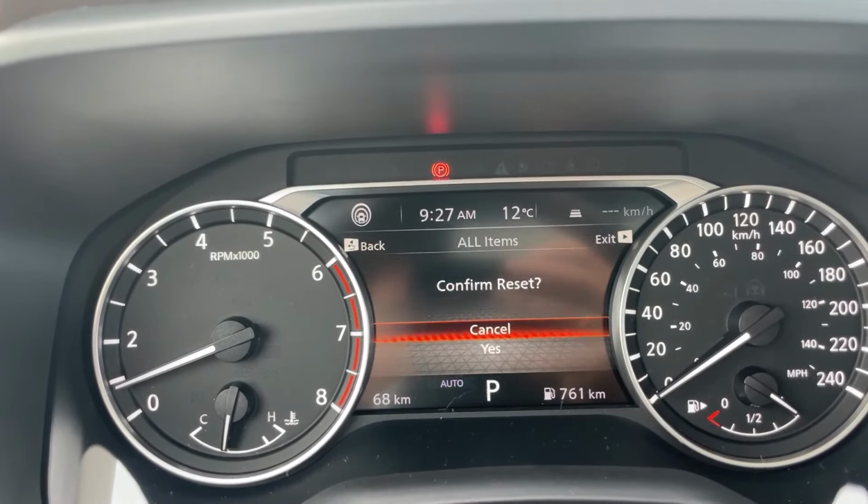Now, your intelligent forward collision warning says if you're driving on the highway or down the road and the car in front of you is there and the car in front of them hits the brakes, as long as it is within range, that same warning system will still happen inside your vehicle, even though the car directly in front of you didn't hit the brakes yet. So again, it's 2 cars ahead as long as it's within range.